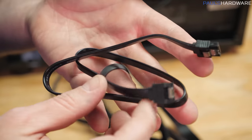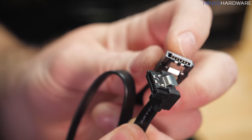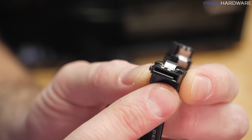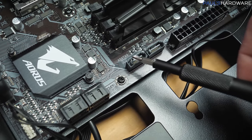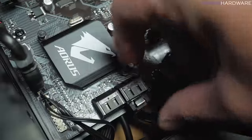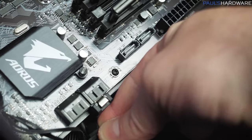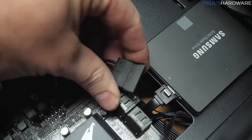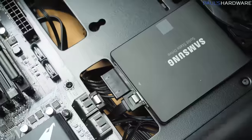Before I plug in all those power cords, I want to plug in this SATA data cable — this comes with the motherboard. The plugs are the same on both sides, with one end angled 90 degrees which can be convenient in some installation scenarios. Bear in mind as you're plugging a SATA data cable into an SSD or hard drive that it is keyed as well — it's got sort of an L shape to the bracket so it only plugs in one way. This motherboard has six serial ATA connection points — two facing up here and a group of four more down here that are angled. I got one end plugged into the motherboard, fed the excess back behind the motherboard tray, and plugged the other end into the SSD. I also grabbed one of the SATA power plugs from the power supply — these are also L-shaped so you can only plug them in one way. Now our SSD has power too.